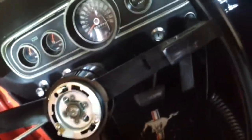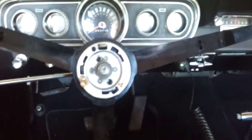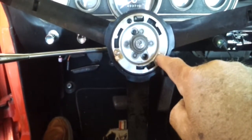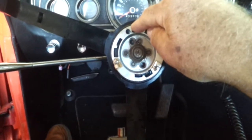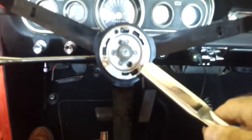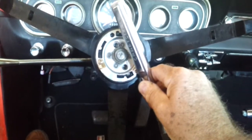Now you inspect the situation here. It's a very simple system, but it is a little confusing as to how it works. Looking at the interior, you've got two contacts here — a contact here and a contact here directly to the battery. And then there's a contact up here that is connected to the top of the horn. If you go to the horns and connect either one of these two contacts to this thing right here, the horn should sound. And in this case, since I've got the horn working, it works.